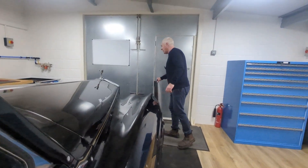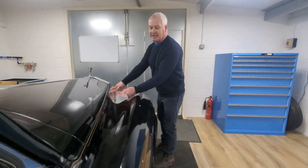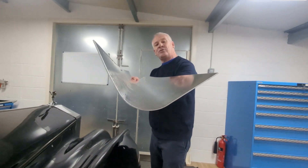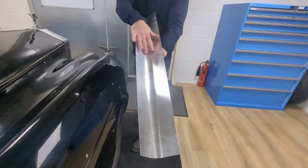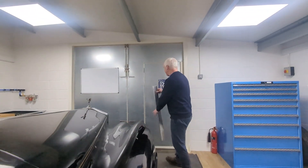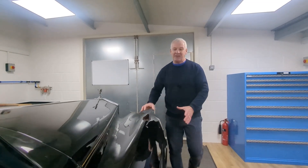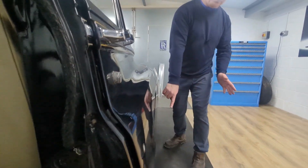This was done on my small roller — you can see it ain't that big. But if you look down there, that's called the canoe effect: it's tight there, tight the other end, but then just shallows out in the middle. You can push this in by hand, but over that length it ain't going to work that well. And especially here, it tapers — and on the floor, the sill tapers as well.